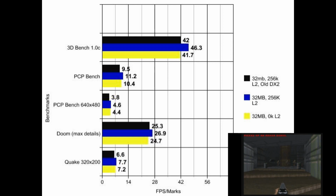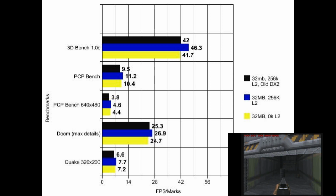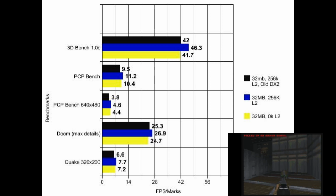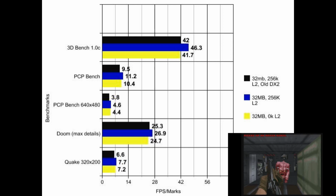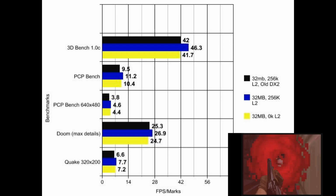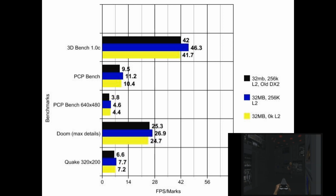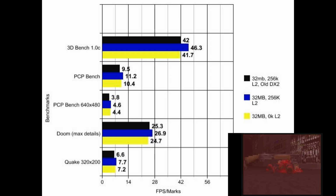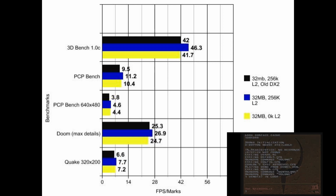I really like it. So the first thing we're gonna look at here is our IO controller. Right here, nothing too fancy, but I do have a VLB controller from CMD Technology. I'm not 100% sure of the exact model here, but it has our floppy drive controller and a secondary and primary IDE controller. A lot of different jumpers here. We have a Winbond chip there, standard serial and parallel port. A little bit of a variation for me.